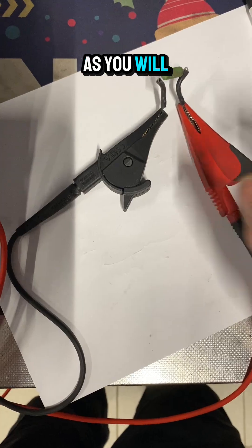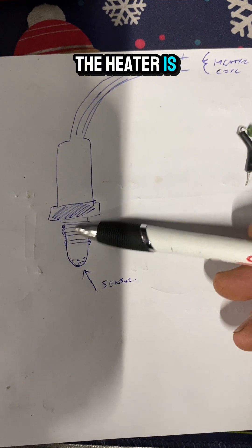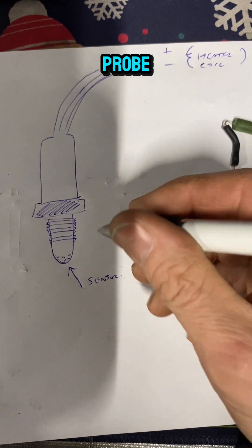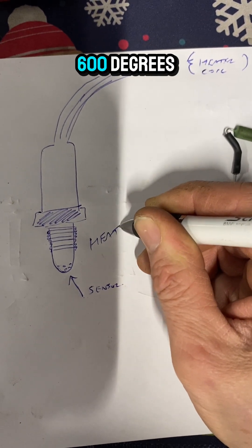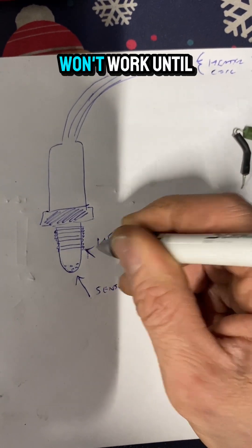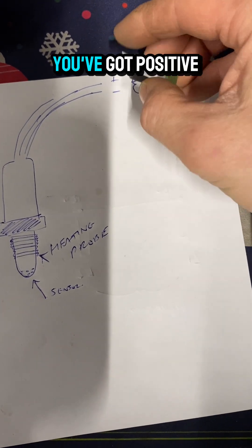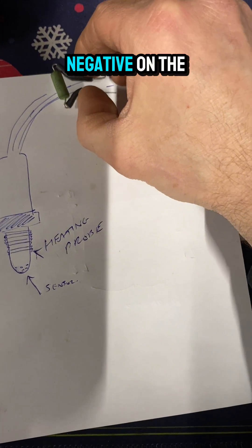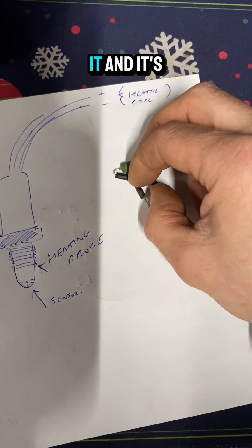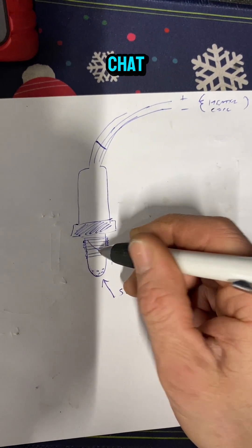When it reads zero L like that, if we see that on our heater we've got an open circuit — and that's what it's saying, but at the time of test it wasn't open circuit. The sensing element is here, the heater is around this area, and it heats up the probe to 600 degrees. The heater itself is just like a coil, like this resistor — positive on one side, negative on the other. The engine ECU, the DME, heats it using pulse width modulation.